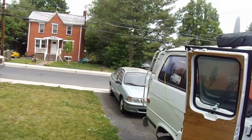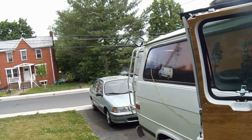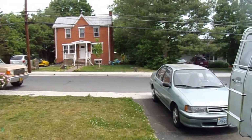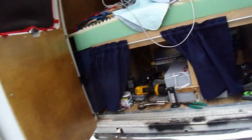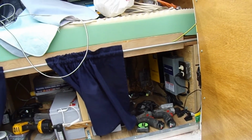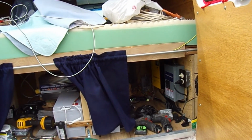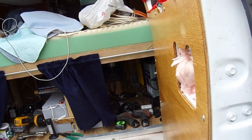So what we have left to do is just basically make some wire connections, a little bit of shrink wrap, a little bit of crimpers, and we'll get her wired up. And since I have a 12-volt fuse box down here with the solar, and see it back there in the back, I'm gonna hook it right into there. It takes a 15 amp fuse to run these lights. That's each set. So we should be good, and it's not going to be a continuous on, so hopefully it'll work out. So let me get the wiring here and get it all wired up.